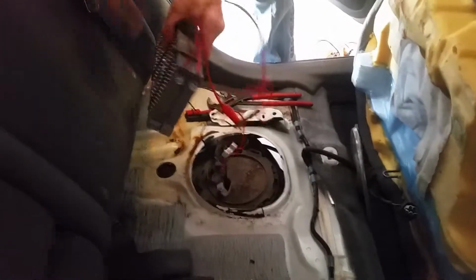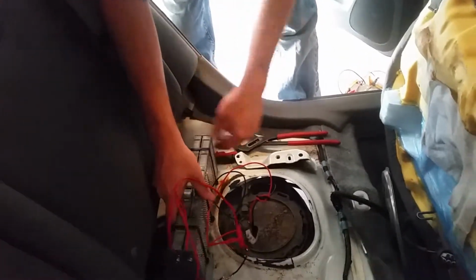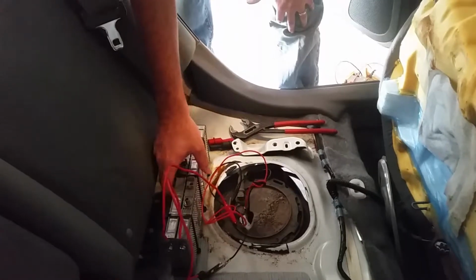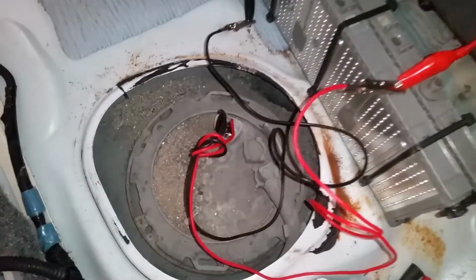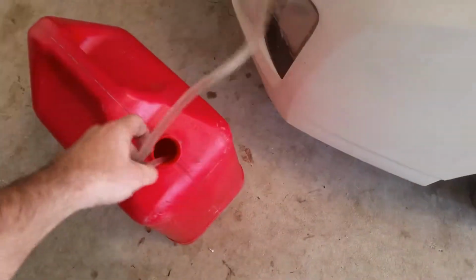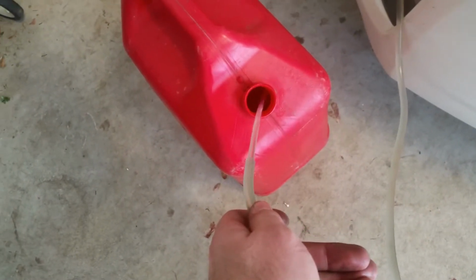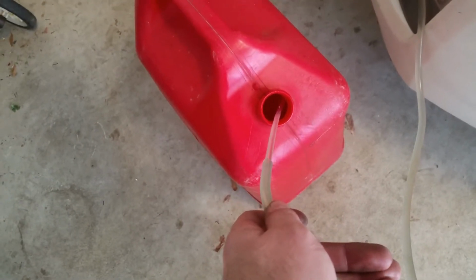There's a link in the description of how I built this block out of 2 dead Prius hybrid cells. But it pretty much holds 7 volts apiece, wired in series. You've got 14 volts right here. We'll hook this up, and you can hear that pump running. And I'll show you the amount of flow that's actually coming through here. So it's a decent amount. It'll take, I don't know, 5-10 minutes or so to fill this gas jug.